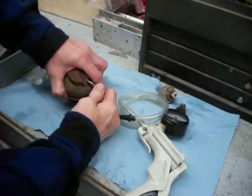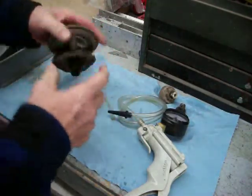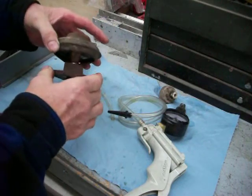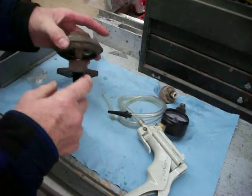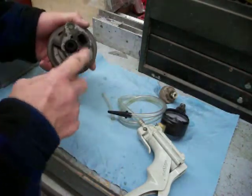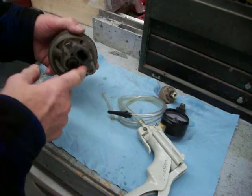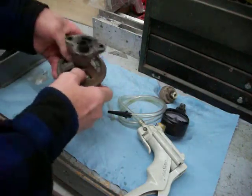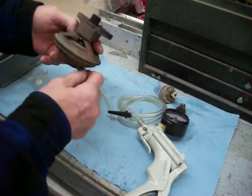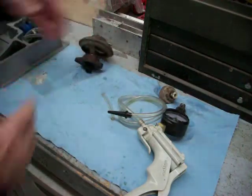So I replaced this. There's not a lot to it — there's just two nuts. It sits sort of behind and to the left looking at it from the front of the car on the motor. Just two nuts, pull them off, pull it out of there. There's a gasket in it that might give you a little grief — you can just pry it out and then replace it. You can see this is like a vacuum unit here that should move when you give it vacuum, and this one's not doing that.